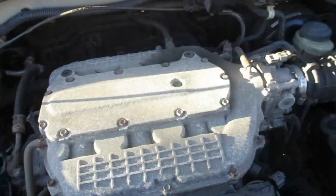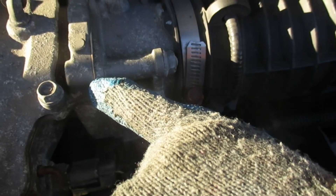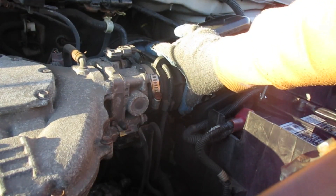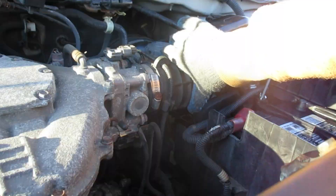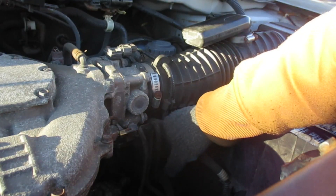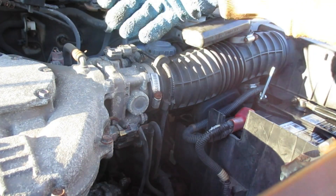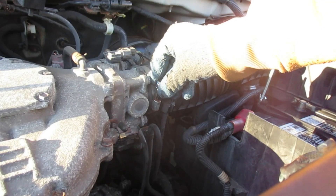We'll just take this cover off here — there we go, beautiful. That gives us better access to the throttle body. You can see it's got the little gasket right there. It looks like I've got to remove this to pull it off. There's also an electrical connector here, two vacuum lines, and four bolts holding in the throttle body, plus coolant lines running to it. All I'm looking to do is remove the throttle body so I can put a rag behind it, maneuver it a bit, and spray some throttle body cleaner in it, then replace the gasket. Looks like a 10mm or something.